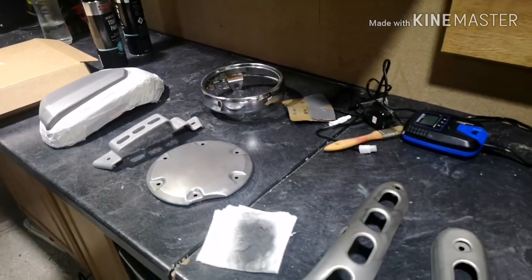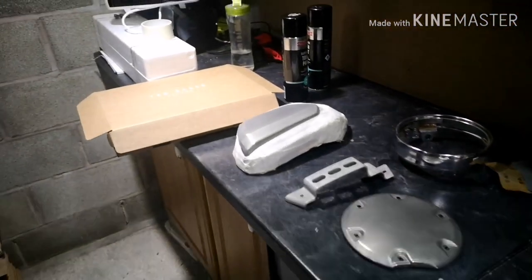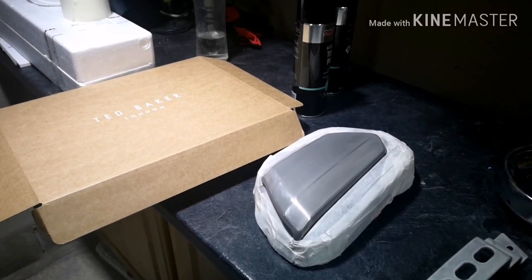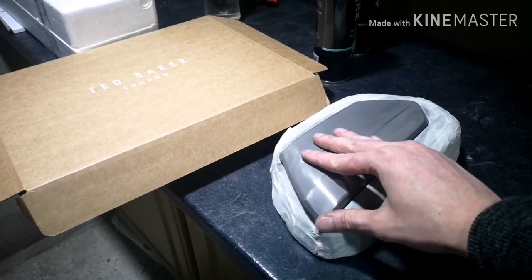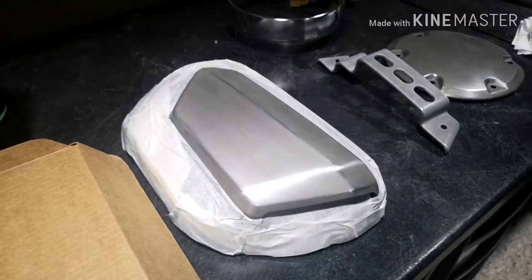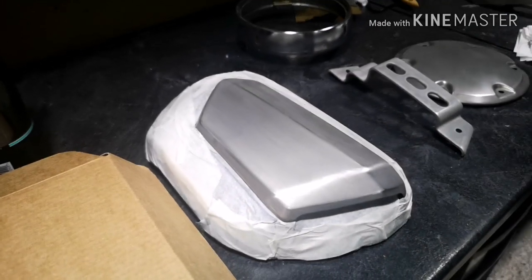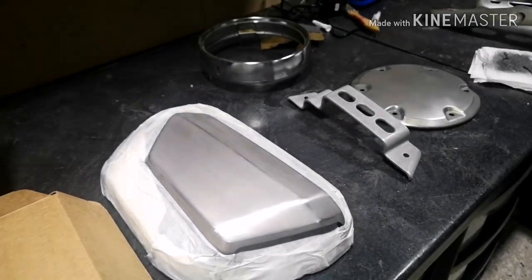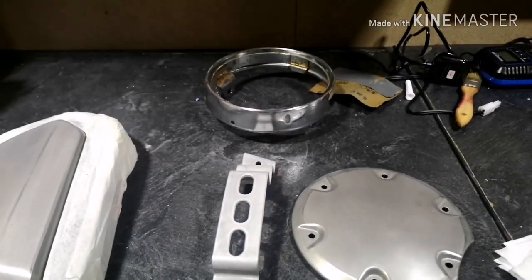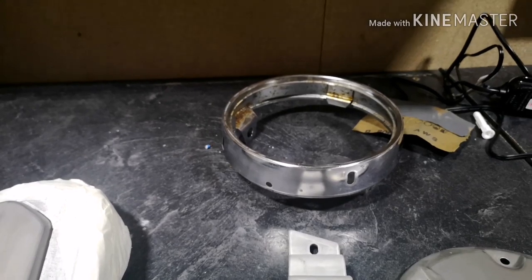As you can see, we've also got some additional parts which weren't in the first part of the video. What we've now got is the airbox, which you saw in episode 3, which we wrapped. The wrap quality within the corners of this was absolutely terrible. So we've taken that off, masked off the bits that we don't want to get painted, and given that a rub down. And as you can see, I don't know if the camera's picking that up, if it focuses there, we've got quite a good finish on that. Gone through to some of the bare metal as well, so we definitely know that we've got a good sanding surface on there. The chrome on the headlight bezel has gone all matte, so we know that we've keyed that quite well.